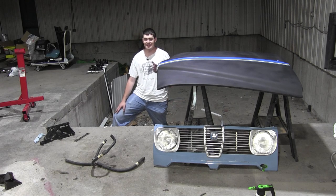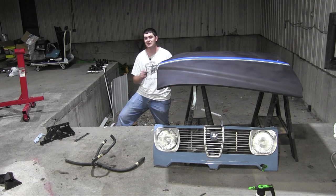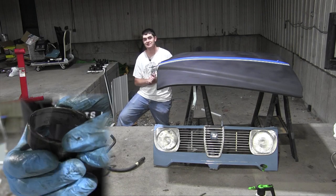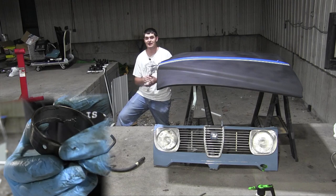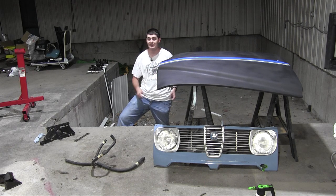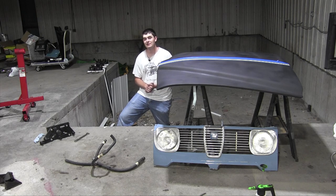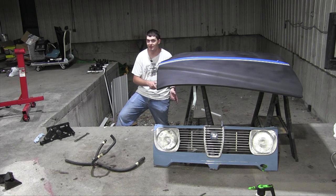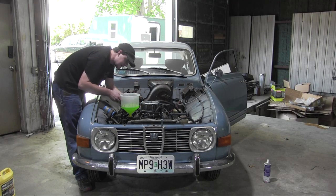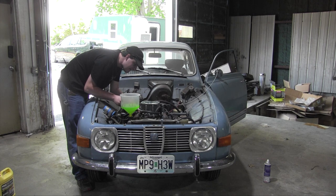So there. The second suggestion you all had was, check the main crankshaft bearings. Because the balance shaft bearings were shot, which I showed you in the last video, the material that flaked off of the bearings has to go somewhere, so you should check the main crankshaft bearings to make sure that material didn't flow around and damage those bearings. And that's a great suggestion. However, by the time that video had come out, the engine was not only back together, but in the car. So I can't really check it now because it's all back together. But it was a very helpful suggestion. I'll remember it next time around.